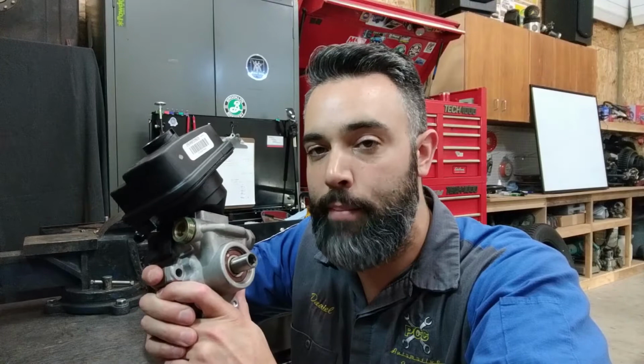The hydraulic power steering pump is responsible for providing enough pressure for the hydraulic power assist system for the power steering. As we covered in hydraulic brake boosters, these can also supply pressure from the power steering system and loop it through the brake booster in order to achieve hydro boost pressure on a hydro boost system. So maybe on a diesel that doesn't have vacuum, or on some other vehicle where the clearance is an issue and running fluid up to the booster is going to be more practical than a vacuum type of booster.